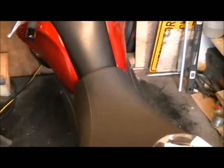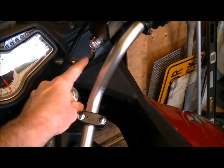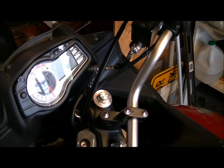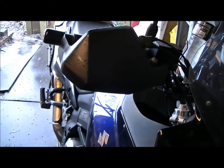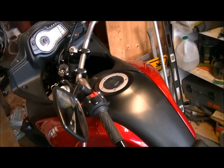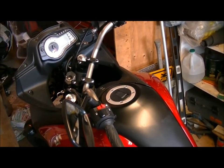But on this little girl — the DL650 — if you're going to put risers on, you're going to have to fix that front brake line. The heli bar, even though it's awkward looking, is a very simple fix. Just ask the shop about those ABS bleeds — it can be a long, slow process. Anyway, that's what we've done to lower this bike, and we've got more stuff on the way. As the budget allows, crash bars are on the way. That's our update on lowering the DL650 2014 — it is Spring 2015, last year's model.